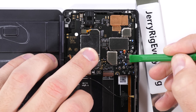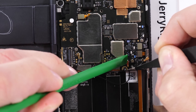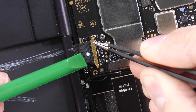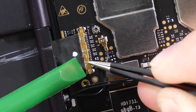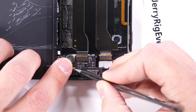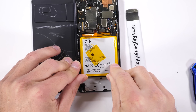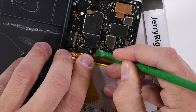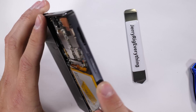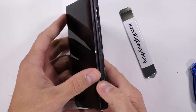I'll get the side buttons plugged in along with the normal front screen extension cable and the charging port ribbon. There are three wire cables going back into place — these are fragile and their heads can pop off if you pull too hard, so I'm being gentle as I push them back into place. Since the secondary screen connector is a bit different than the rest — mostly just more thin — I'll clip that in with my tweezers and plastic pry tool. The charging port board can snuggle back into place. There is no water resistance on this phone whatsoever. I'll put the loudspeaker back over the charging port with its five black Phillips head screws. Finally the battery, with its now-ripped-off pull tab, can slip back into the square slot it came from. I always like to plug the battery in last. Before we can test the phone, I'll get the silver bracket back into place with its two screws, and then I'll press the power button. So far we have at least one screen going, so that's good. I'll smash the back panel back into place with its seven screws — and it's a success.